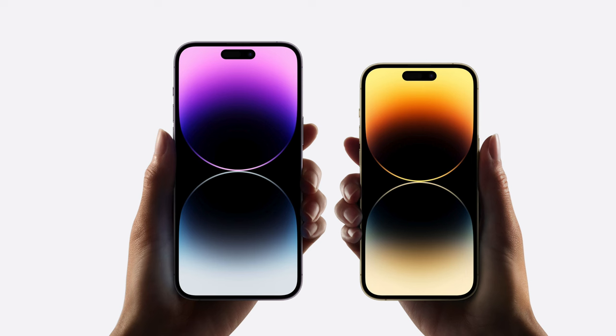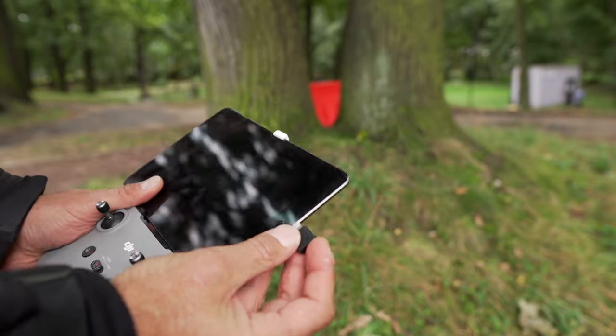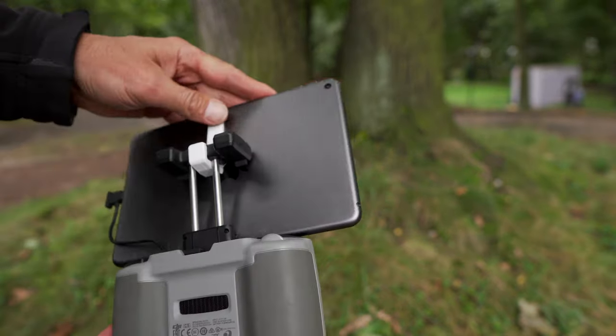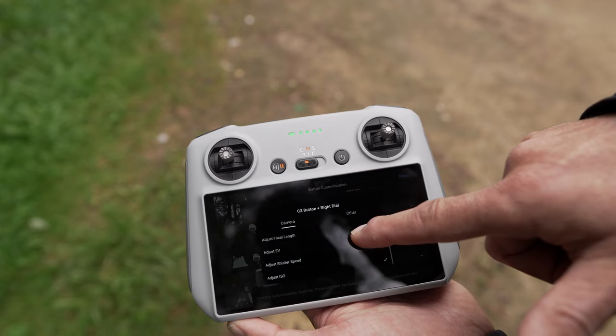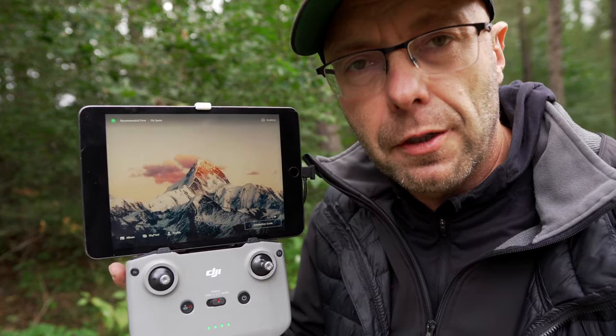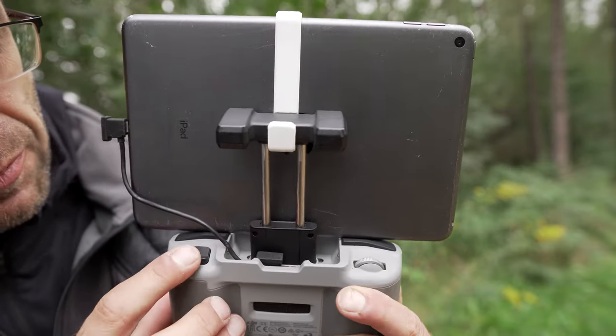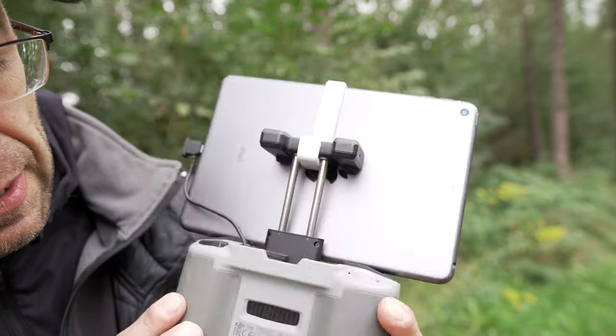Another very important point: if you have a high-quality phone or tablet with a good processor and a great display, you may actually get much better results than with the DJI RC with its built-in screen. A big advantage is also that if you use a phone or tablet with a SIM card, you have direct access to the network. You can also use other apps on that device, which unfortunately is not possible with the DJI RC — where you need Wi-Fi range or a hotspot from your phone. With the DJI RC N1, you can use both Android and iOS (Apple), and the performance of that system is noticeably higher.